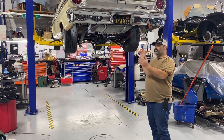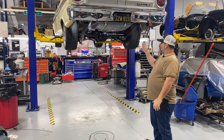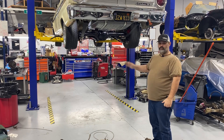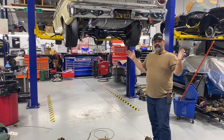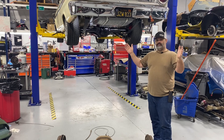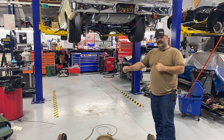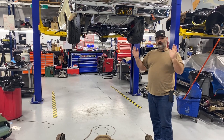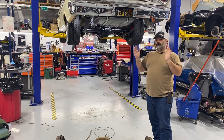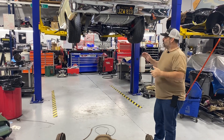You get an 8.8 out of an Explorer. Grab one with disc brakes if you want to do disc brakes. You narrow it on the long side to equal out the short side. Overall you will end up with 56 and a half inches from hub face to hub face. When you do them in the Fairlanes you lose a half inch on either side, so you get a little bit more tire, and in these cars that is a wonderful thing.